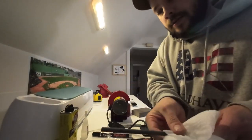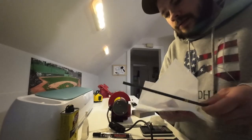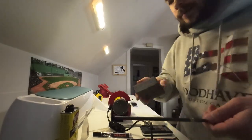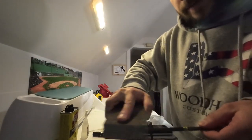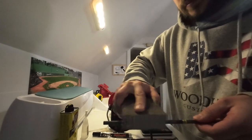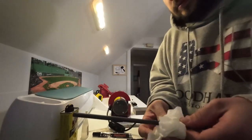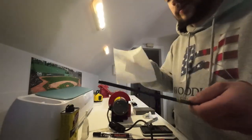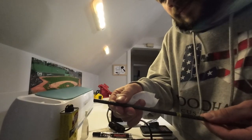While I'm doing it, I'm slowly rotating it. Take a wet paper towel. Wipe off that carbon dust. And take a dry one. Then you can kind of feel, I can feel there's still some more glue. I'll hit it again. Pretty firm pressure. Slow rotation. Dry. Perfect.